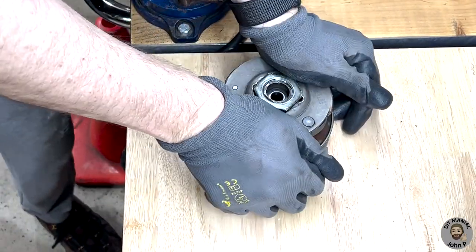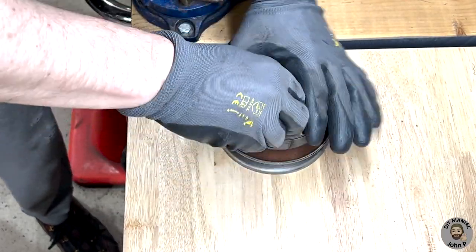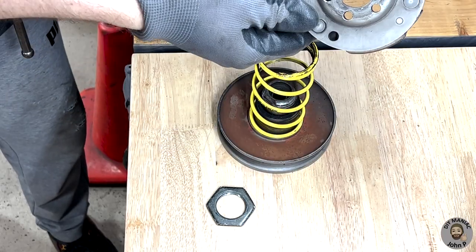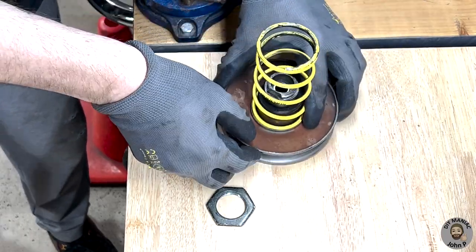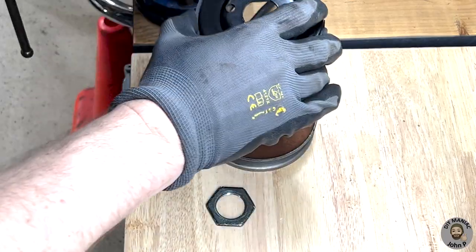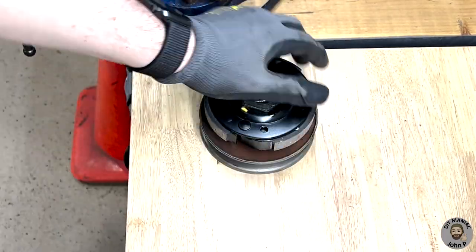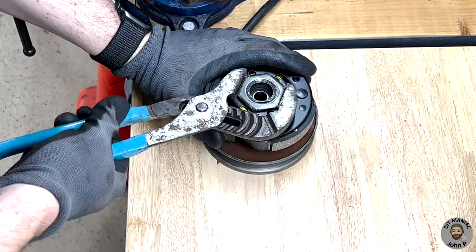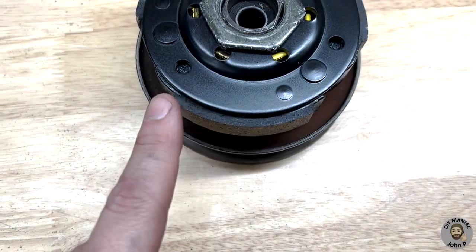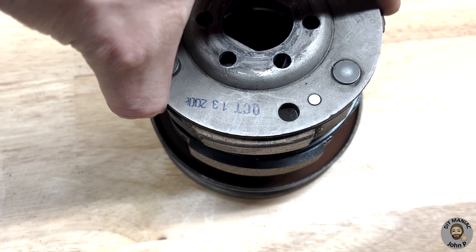With the retaining nut loosened, it can now be taken off the rest of the way by hand, keeping in mind there is extreme tension put on it by that spring. Push down on the assembly and unscrew the nut by hand, holding firmly. Once the nut is removed, release gently, taking pressure off the spring. When installing the new clutch, take note that there are flat edges that need to be lined up to the corresponding surface on the pulley. It is advised to have two people — one to push down on the clutch and put tension on the spring while a second person tightens the retaining nut. The following demonstrates just how worn the friction material was on the old clutch and how much larger the friction material is on the performance clutch.